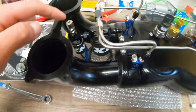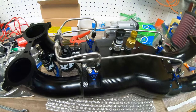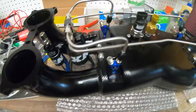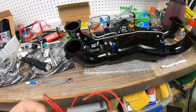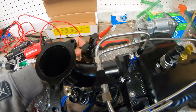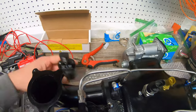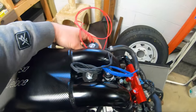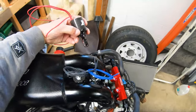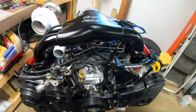At this point it's half done. Here are the purge solenoid and nitrous solenoid — all these lines are bent following the curve of the intake so you can barely see them. The jets are in for each nitrous nozzle and we have room for the connectors. The fuel solenoid couldn't fit in the same gap, so it's going to sit behind and offset, with the distribution block turned so the four fuel outlets go over to that block.